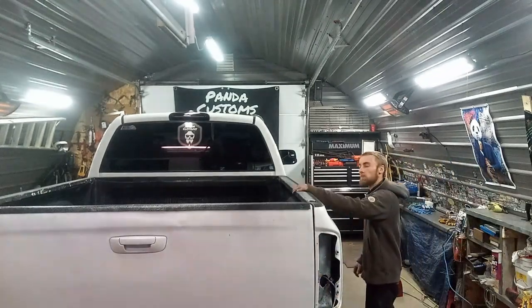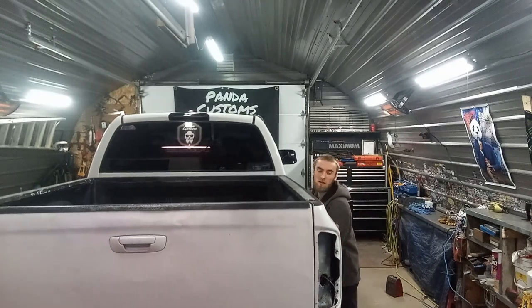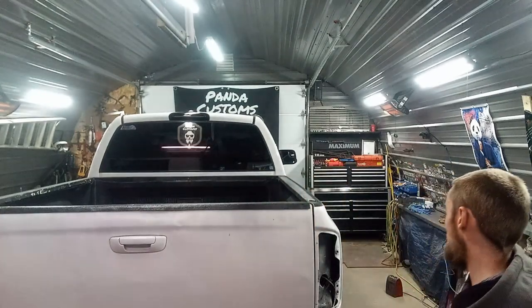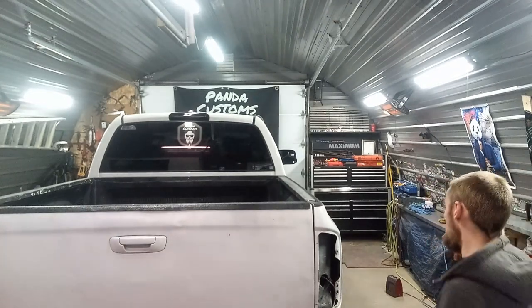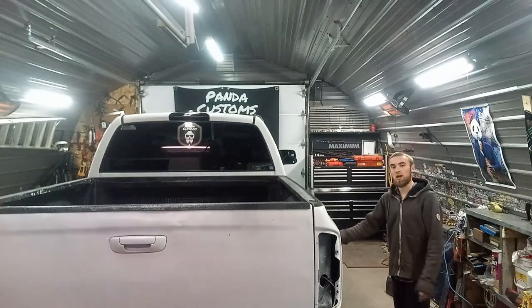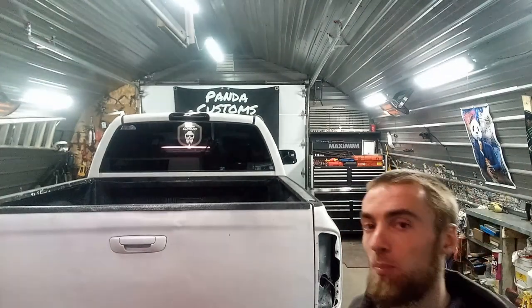I'm going to pull the tailgate off next. And I got all the bolts off for the box. It's really just sitting there. I need to take off the gas filler neck. And then, yeah, the tailgate, and it's ready to come off. Oh, I still got the mud flaps and the wheel wells. And then I'm going to put a 2x4 on the jack on each side, lift it up, and then drive the truck out. I'll show you the bolts I'd take off underneath right now.